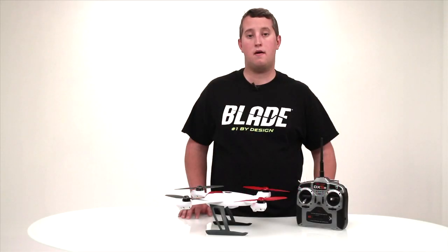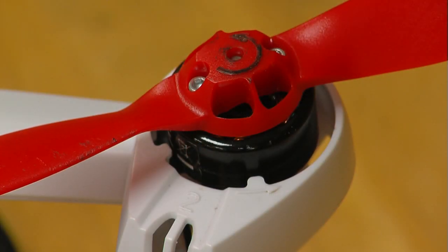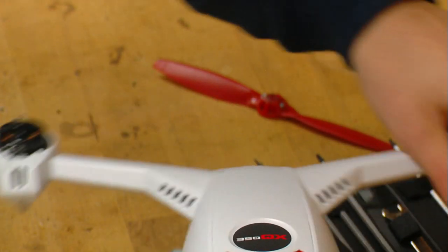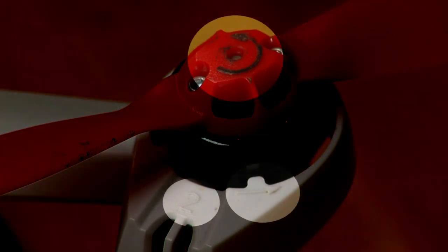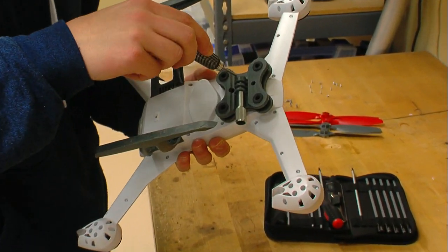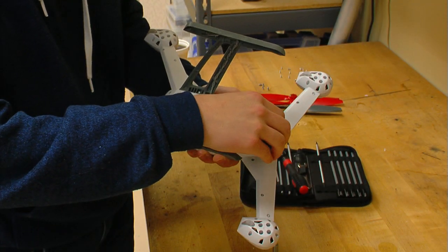We're going to start out by removing the propellers and anti-vibration camera mount. Each propeller has two 2mm screws, which we will remove. Each propeller has its place on the 350QX. However, we have made it easy to install them again since the rotations are marked both in the propeller and on the fuselage. The anti-vibration camera mount is removed by unscrewing the GoPro case and removing it, as well as removing the 4 screws that hold the mount to the fuselage.